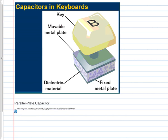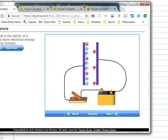So there's a certain distance where charges can't get through, and they just basically figured that out? Correct. That would be manufactured so that the charge that they put on that capacitor from your keyboard, from being plugged in, or the battery that's running it, will not discharge at the unpressed distance. But when you press it, it will discharge. And they just figured it out. Exactly right. So what's the difference between that and a mechanical keyboard?